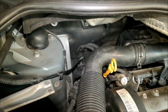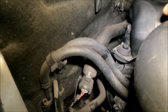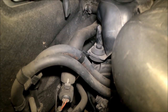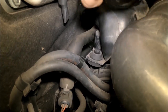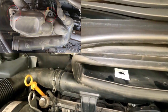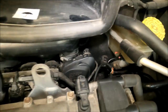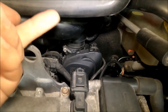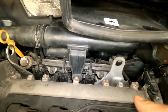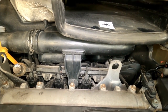First I will remove this connector from this plastic tube. There is one screw that holds here this plastic part, and at the back there is a rubber part that holds it. After unscrewing that front screw, you just pull it up. There are two screws — I'll put a photo up. We also need to remove this clip, then there is also a screw on the throttle body to remove this plastic part.